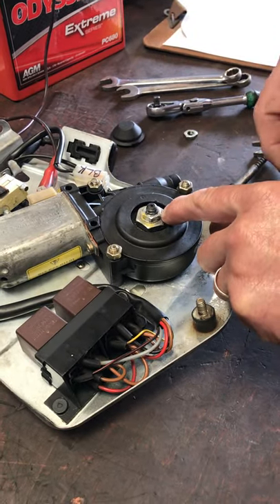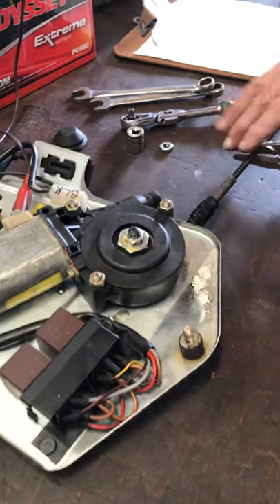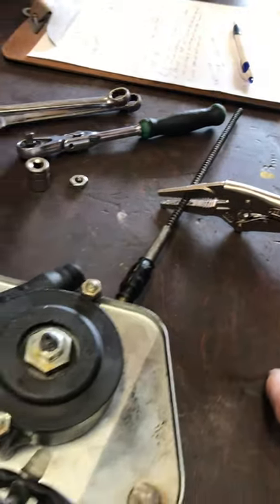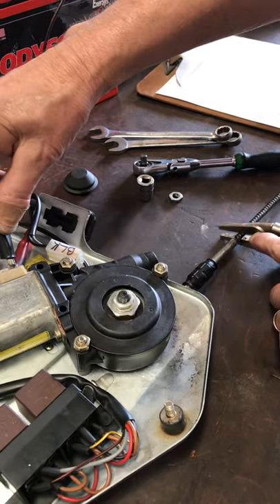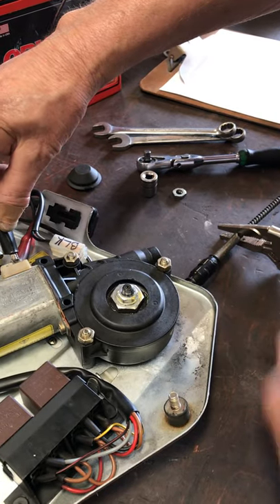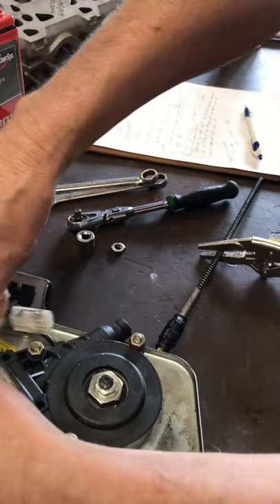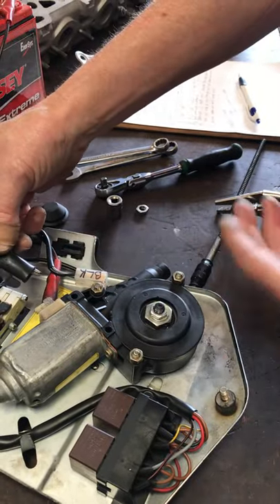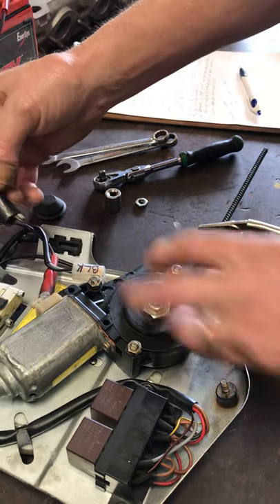I used the 13 socket and held the 22 and got that 13 loose enough, just keep going until the motor slips. We did that by simulating a load on the sunroof system by just clamping on the lift cable. You can see when it comes to the end — the motor still running, you can hear it, but the clutch is slipping. You can reverse polarity, which is what your rocker switch does up in the cockpit by the shifter, and pay it out again. If you set your sunroof halfway open, whichever way you rock it you can see if the motor is clutching or not clutching.